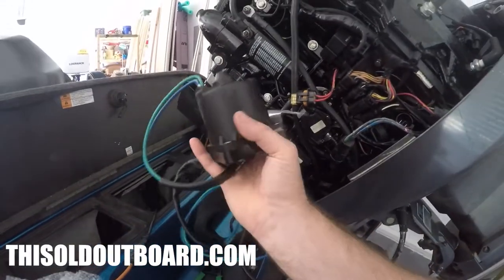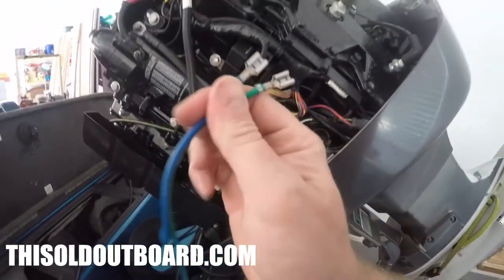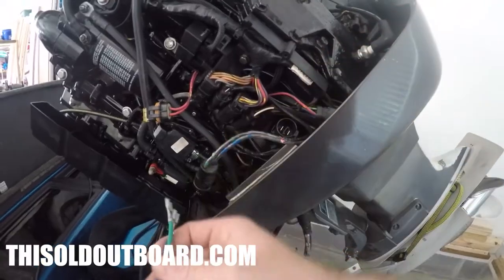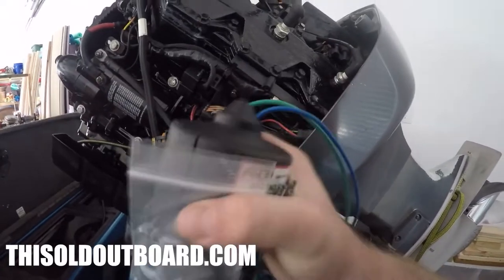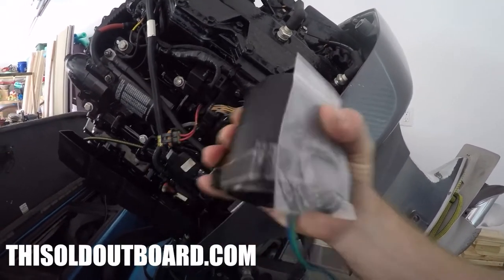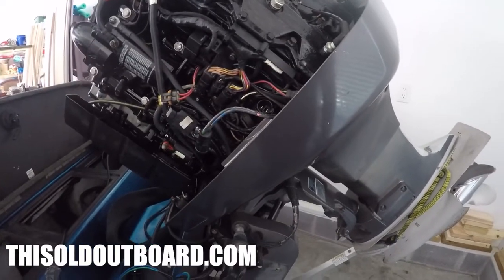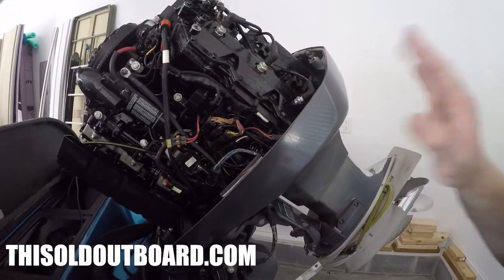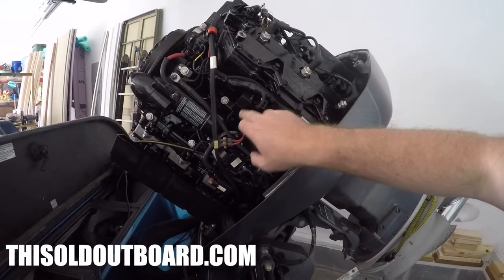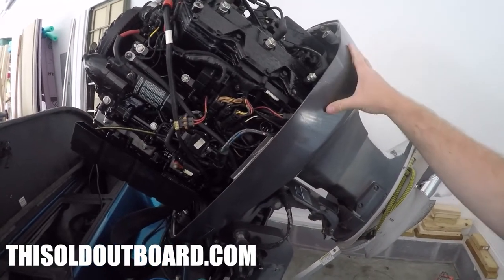I'm going to buy a new motor — I got this one off of eBay. What you can do is take your two leads, plug them into the connector, and go actuate your up and down switch. Have a friend hold it while you do that because this thing is going to spin and put off a lot of torque — it will flop around if you don't. But if that works, you've pretty much confirmed it is your motor. If it's your relays, just replace your relays. If it's your motor, it gets more complicated because we're going to have to take off this lower cowl.